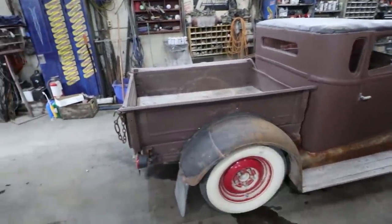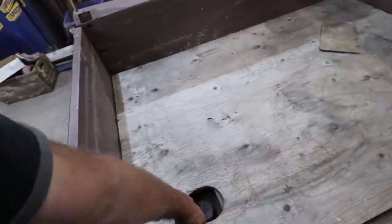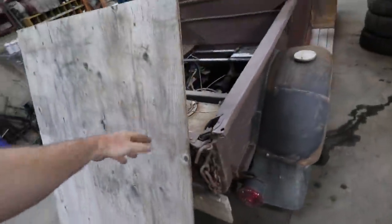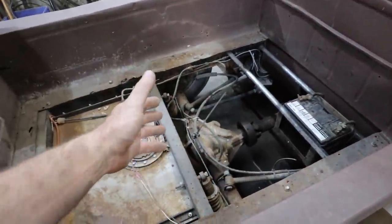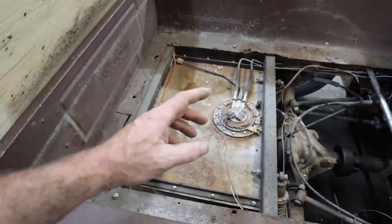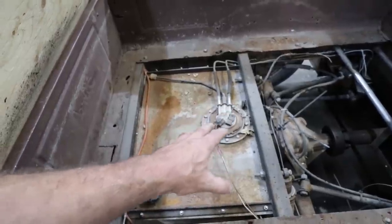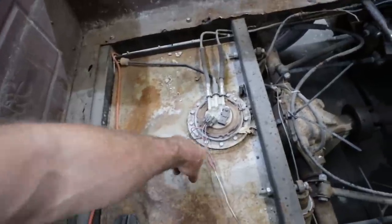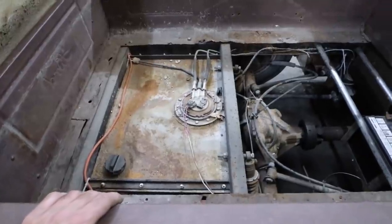But yeah, so I built the frame underneath it. It's got a... let's see. If I can get underneath here. Oh, yeah. So I pretty much built the frame. It's got a kick. Nothing crazy. 4-bar rear. It's got a two-wheel drive S10 diff with a posi. The fuel tank, I made the fuel tank. And then I stole the sending unit and everything out of like a Silverado pickup. And basically I cut it out of the plastic tank and I sandwiched it in there, bolted it down. I don't know, it hasn't leaked, so I guess I won at something there.